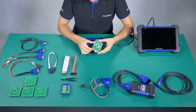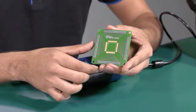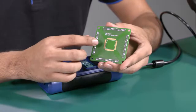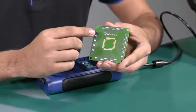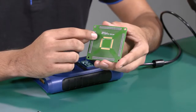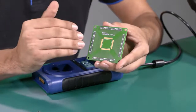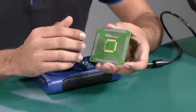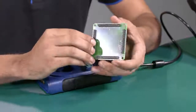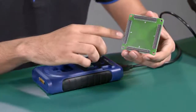Let's make an example. This one, for example, is the APV107. In this case we need to weld the MCU here on the board at all of these parts, and then we need to make sure that it's according to the right position at the dot on the board. After we weld the MCU, we need to connect the board with the UP400 by these pins.